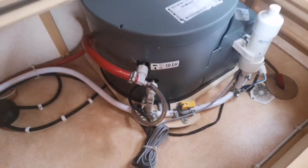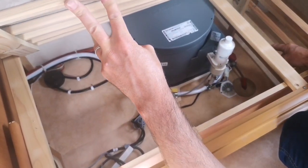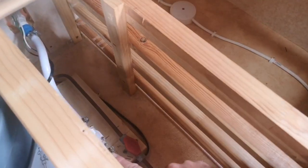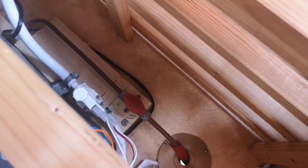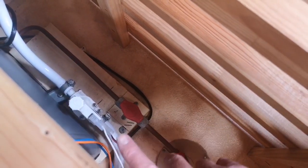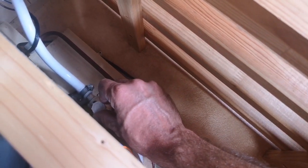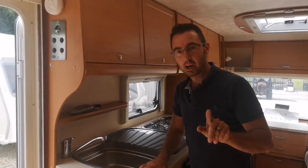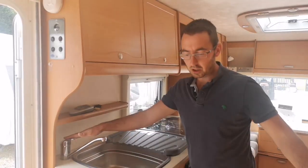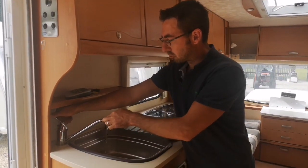There's not really a lot else to do in this area. Just on this side here is our pressure switch. If you find that the water pump is coming on and off quite a lot, this may just need adjusting. To adjust it: turn clockwise to add pressure and anti-clockwise to reduce the pressure. Now that we've checked our water system is ready - the drain-off bung is closed, all taps closed - we can now confidently put our water pump into the on position and open our tap to draw the water through the system.